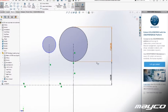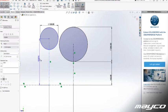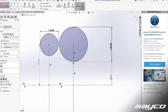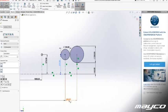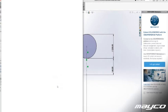So yes, potentially for that reason it could. And the other reason I don't want to do it is because I want to allow a lot of different body styles. So it's the same, I don't want to run a suspension strut in the front, but a push rod setup, is because I don't want to have a big part of the car hanging out there.